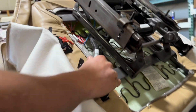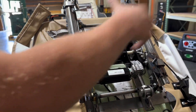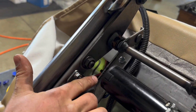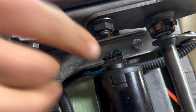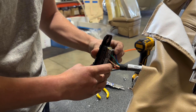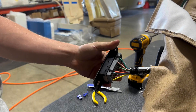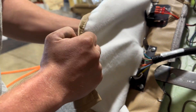You're going to feed this through now. If you look at the colors of these wires and then look at your six-way — as long as you put your six-way on the same way as it was on the other chair, there are some plugs here. On this one the blue and green are in the back, so you're going to want your blue and green to be in the back to line up with the six-way. This only goes on one way, and someone at some point had drawn an arrow on it, but you can make a mark or a little notch with your knife — that's how you line it up.